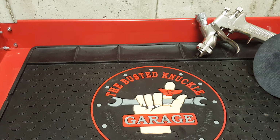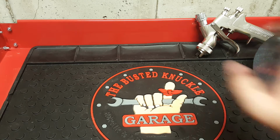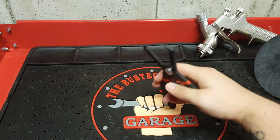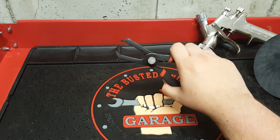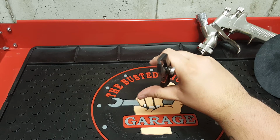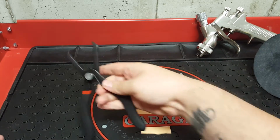When you're working in the field, you're going to be taking apart items. Bumpers, and more bumpers. And one thing that you need to deal with on the bumpers is the plastic clips. Those freaking pain in the ass things. Well, don't use a screwdriver because you always have the risk of breaking it. So, use this. This is the push pin pliers. I also have a video on this, I'll link in the description. These are amazing. You just poke that in on both sides and then pull, and it comes right off.